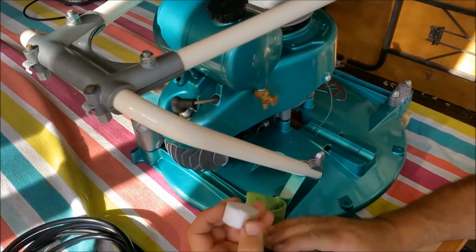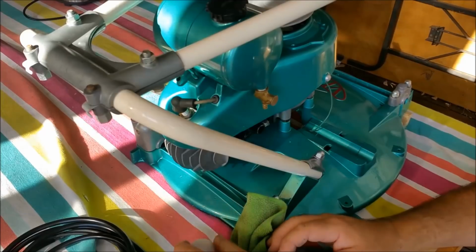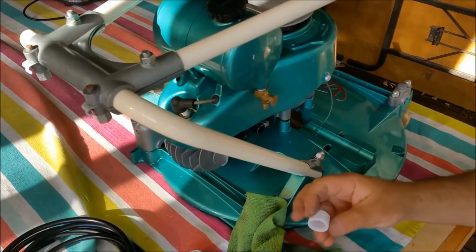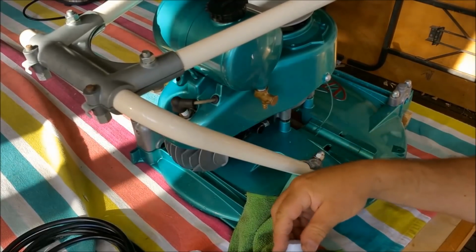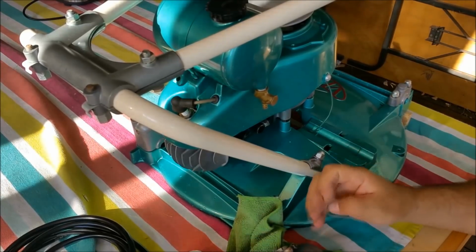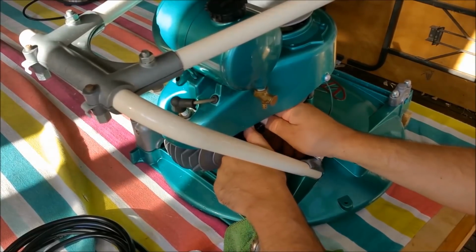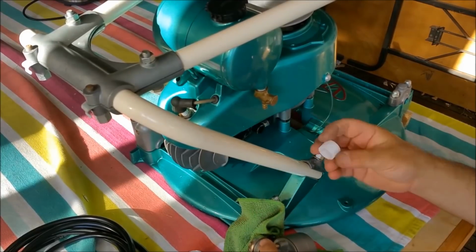My favourite material to turn is Delrin. It's beautiful. I've only got that much left of the big stuff. I've got some small ones that I got from Richard, a friend of mine. My first attempt was too loose on there and too tight there, but I made another one. In order to make it seal, I'm just going to pop an O-ring down, and there's a sort of ledge on the edge of the cylinder where that can seal, and then that will slide over.